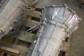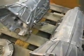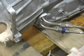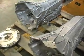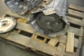We're installing this tranny in a little pickup with an LS3 right now. We've had several of the six-speed automatics going — we even had some at SEMA — so they're really working out good. We've got our programming down and we can run all the 58-tooth reluctor rings with any of the new automatic trannies.